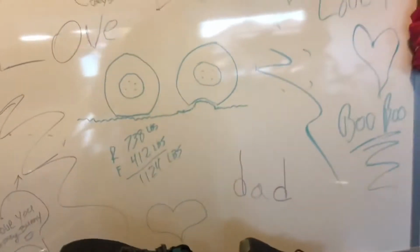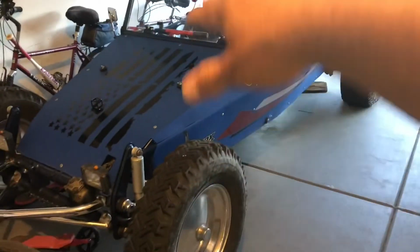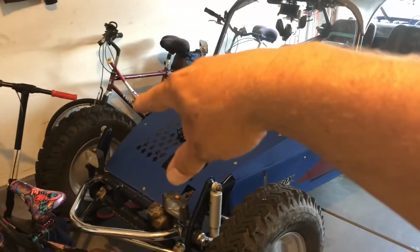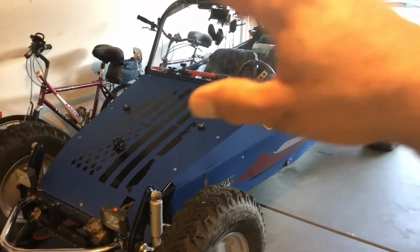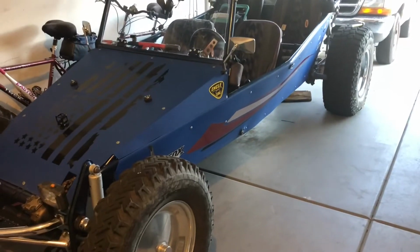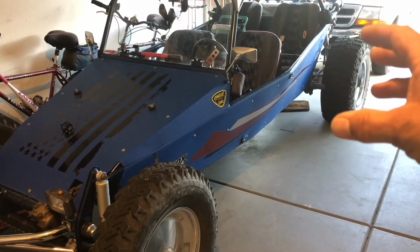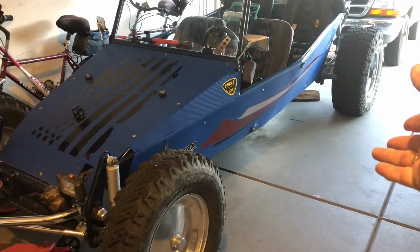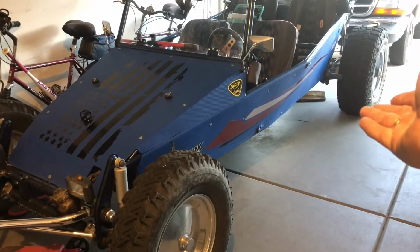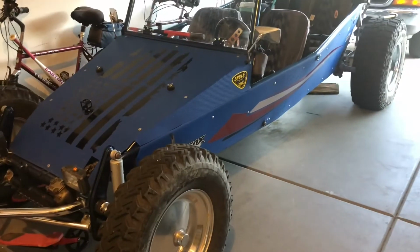time. So that, my daughter's drawn all over my board, sorry, but that is why these dune buggies will get a wheel off 4 feet off the ground, that wheel will stay on the ground, and those two are planted. And they will just literally crawl right over rocks without spinning a tire. You can imagine what it would take for that tire to start spinning when it has 1,000 pounds on it, or divided, so when it has 500 pounds on it, and it's got 180 square inches of contact surface, it's not going to spin. It's just going to crawl.